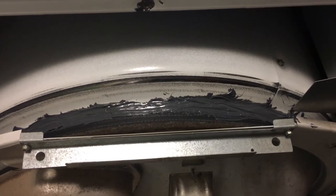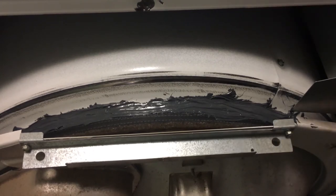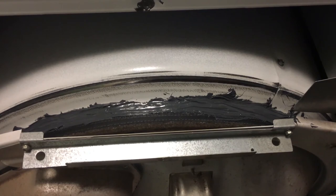This will set in about 4 to 6 hours and will be completely cured in 15 hours, but it will reach its maximum strength after 24 hours. Let it cure for 4 to 6 hours to set, it cures in 15, and after 24 hours you can put the dryer back together and start using it. That is how to fix a crack or hole in a dryer drum. Feel free to subscribe for other videos, and like and share this video to help save people money if they have a problem with their dryer drum.